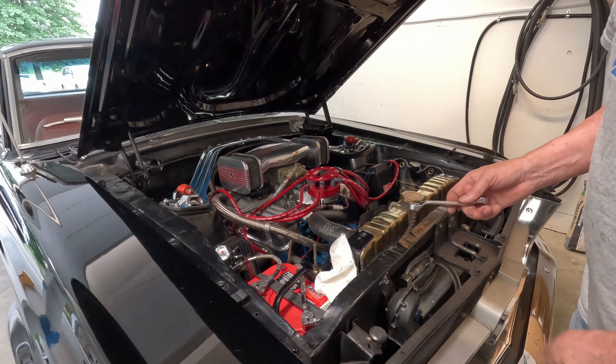You need to buy the 9503 — that is the correct one. We did our measurements off the flywheel, and this is the correct one needed for our car. I've owned this car for 40 years and I know the bell hasn't been changed out. To know which starter to use, take the old starter out and measure from the mounting surface to the teeth of the flywheel. If it measures around 700, 710, or 750 thousandths, you need a three-quarter inch starter. If it measures around three-eighths — which is point three seven five — you need the Powermaster three-eighths, which is the 9504.